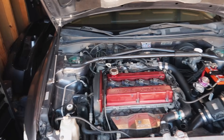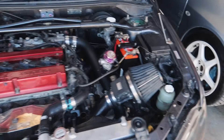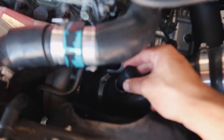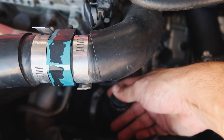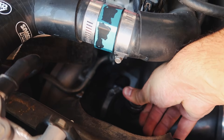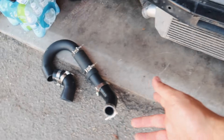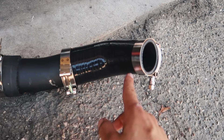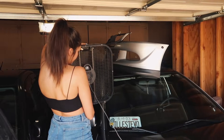We're back at the garage. It's extremely hot — like 90 degrees. She does have to do her rotors and calipers. I basically have to plug in the MAF port temporarily until my speed density intake comes in. I do have to install the intercooler pipe on the low side — I got the new coupler for the turbo which goes from 1.75 to two and a half inches, going all the way down, just trying to push out all the hot air.